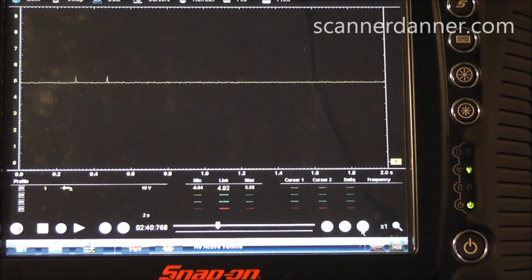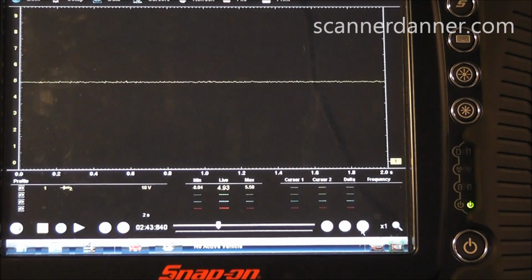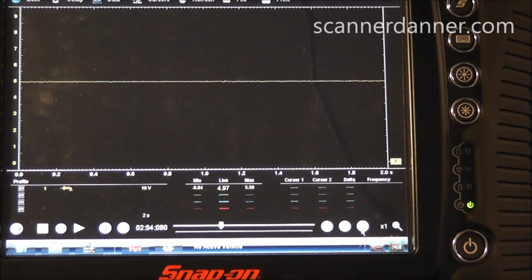Very nice. Now this thing, again, won't run great with this map sensor unplugged, but that is a confirmed fix. Go ahead and shut that back off. Shorted 5-volt reference circuit. How important is it to know the process we went through when you see something like this? I think it was critical, and it's going to be, like I said, a great review for, I believe it's section 10, it might be section 9, where I have all this stuff listed in order on how to do this. You don't see these often.